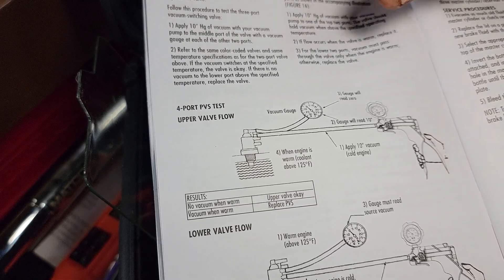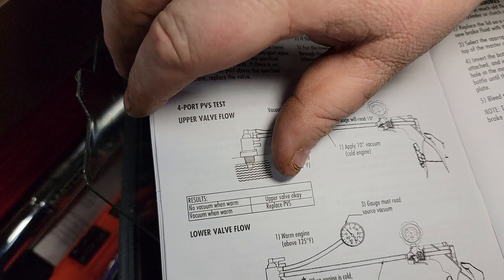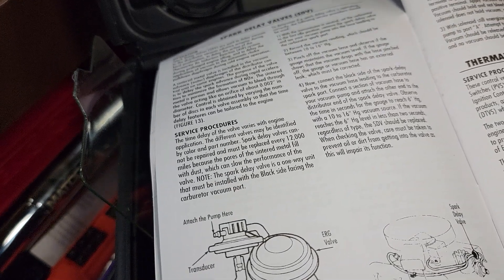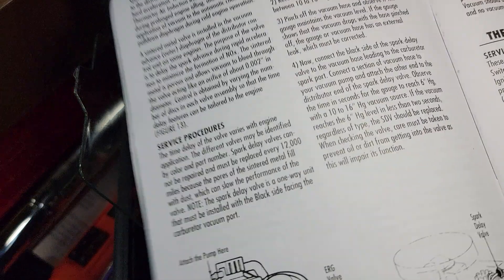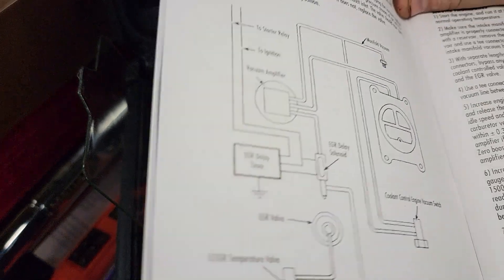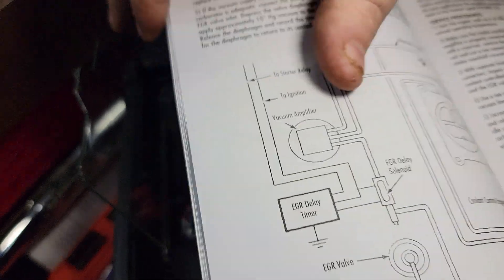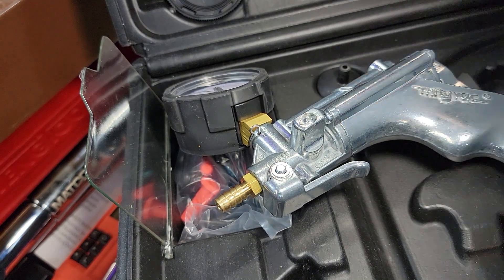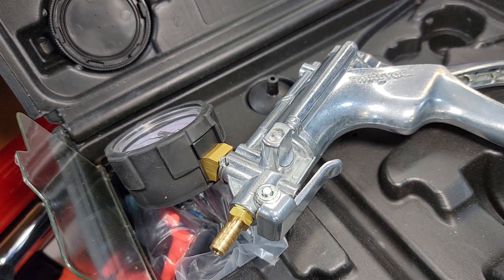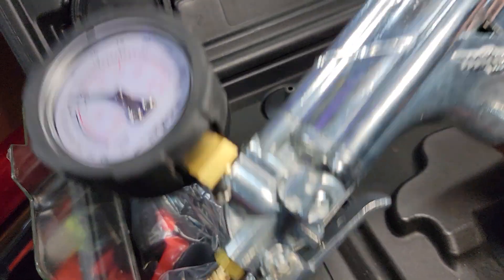My other one I used all the time but it was plastic - the MV8000 is a little bit cheaper. They sell them as brake bleeders but they're really not just brake bleeders - they're great testing apparatuses for a lot of different sensors: electrical vacuum solenoids, thermal controlled switching valves, spark delay valves - you name it. How many of you guys would sit there and suck on those things until your cheeks hurt? For 69 bucks I feel like this is definitely worth it. The mighty vac is a good tool - I've never had any problems with it.